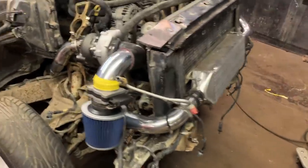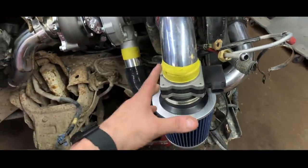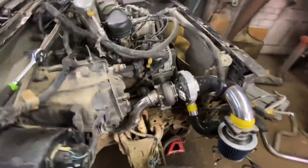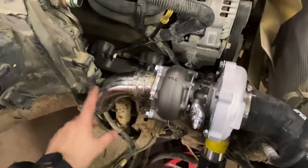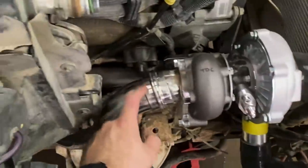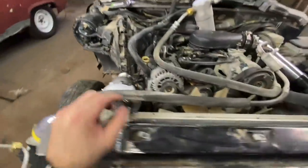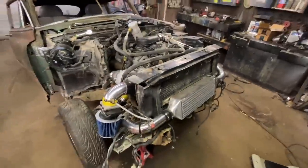The next day — good lord! Looking so pretty! Oh my gosh, starting to look like something! Masking tape is NHRA approved, so I can race like this, just so you know. It's pretty good fitment. Still need to do some TIG welding on that, but pretty much got that side done. I welded it a little more solid — it's still not great, but this is all gonna get exhaust wrapped. I still want to TIG weld this flange because it'll look a lot better than a sloppy MIG weld. We are going to do that later. For now we're gonna try and figure out our bottom exhaust.